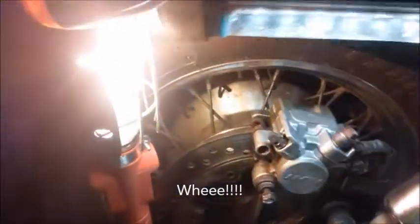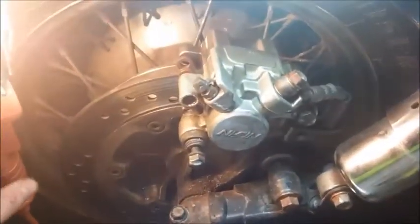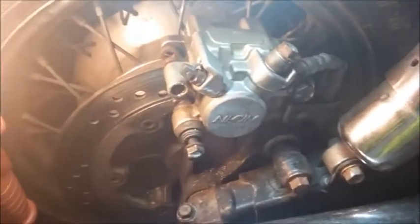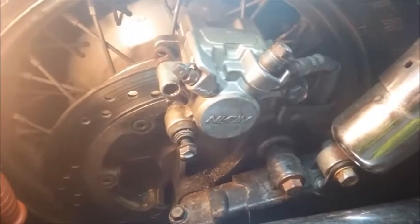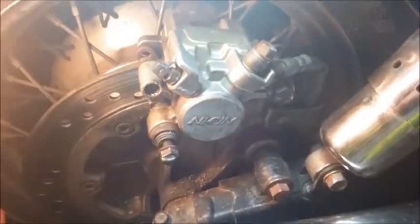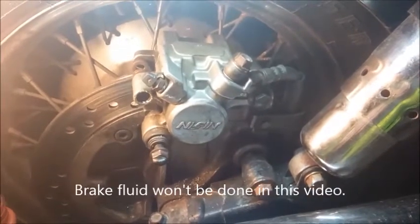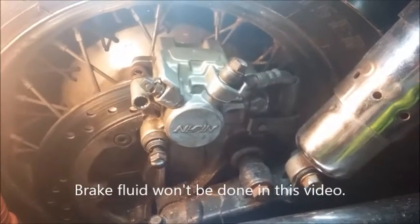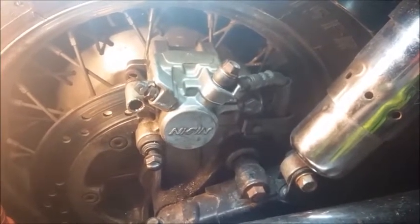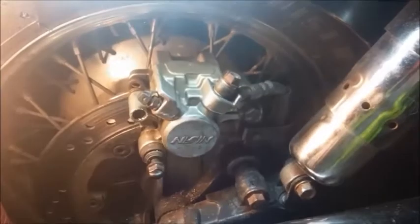This is not working. Poor lighting today — we're in one of the shops and it's raining, so I'm going to use light like this, unfortunately. So we're redoing the rear brake here: removing and replacing the pads, we're going to flush the brake fluid — it's never been flushed since we've had this one. And we're going to bleed the brakes, of course, and tighten everything up.